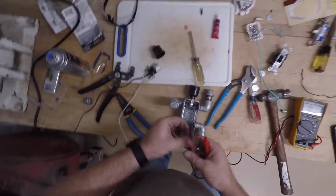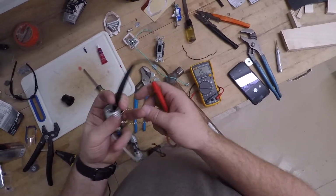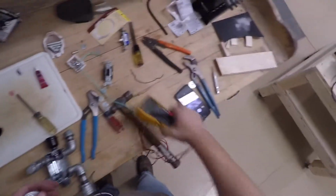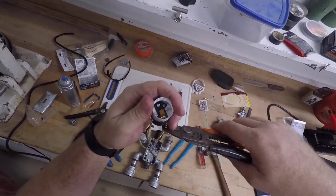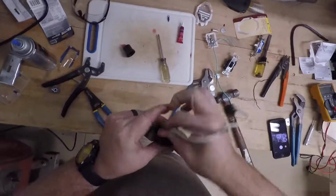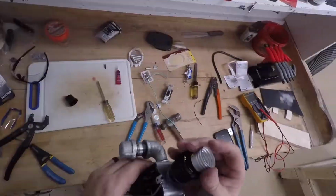And then get at the meter, and I'm checking for continuity here. There's no indication on these pull switches when it's on or off, so I just put this on ohms, and when I got no resistance, I figure there's continuity through there. Pull the cord, make sure I'm right, and then I leave that switch on and cut the pull cord, because I don't want to have two switches on this little bitty lamp. So you can see I cut it there, and then I'll assemble it without access to that pull cord. And then at the front of the robot, there's a toggle style switch. So that's just what I'm doing here, and then finish assembling the lamp part of the head of the robot.